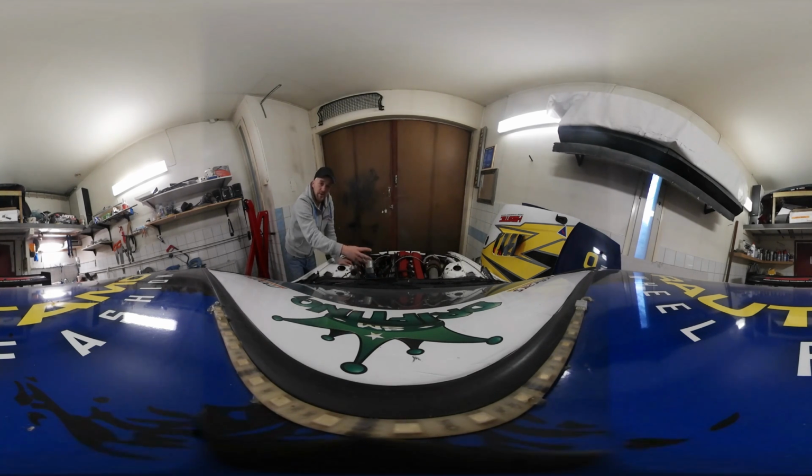Over to the engine and driveline again. The gearbox is a BMW 5-speed diesel gearbox welded together with an M104 bell housing. So the bell housing is welded. You have the Mercedes part that is bolted onto the engine, and the rest of the gearbox is from the BMW. So that's it, and that comes further down.